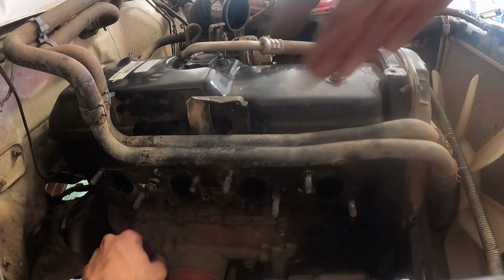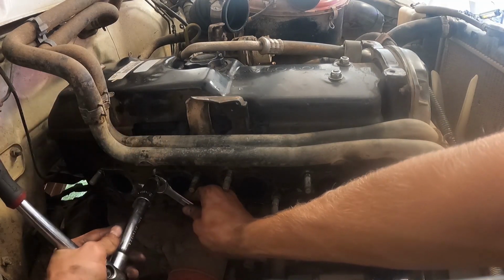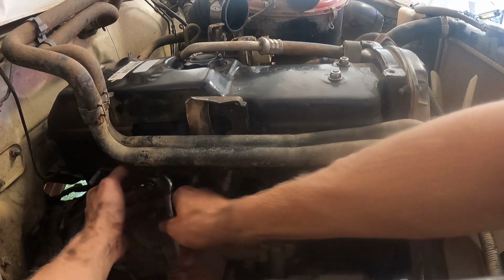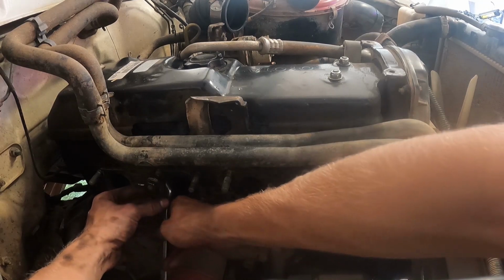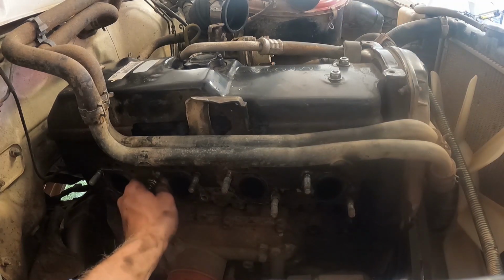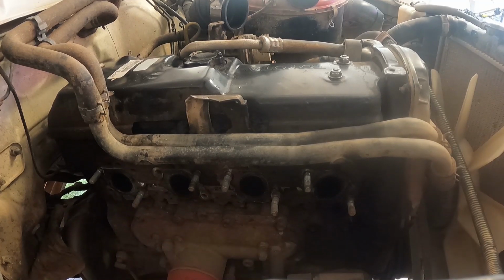So I'm going to grab a spanner. And I'm going to chuck the spanner in here, whichever way works, and tighten it. Now it's a bit tricky because I have to reach around the camera here, but there you go. As you spin the rear one, it forces the whole stud to spin. And boom, stud removed. So I'm just gonna clean out this hole down here and then chuck it in there.